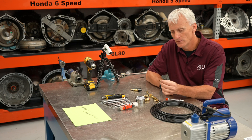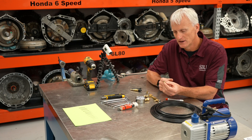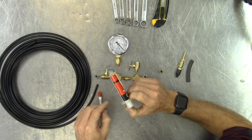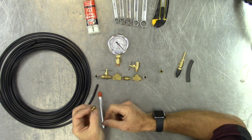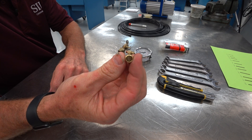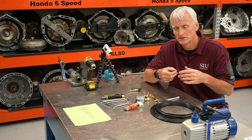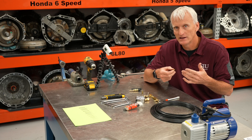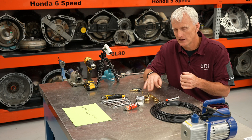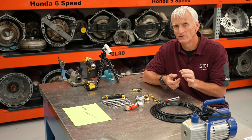I've filled part of this little nipple with two-part epoxy — you mix it up and put it on the inside of the nipple. You only want to fill it about an eighth of an inch with epoxy. I made a couple of them just in case. After that hardens up, we drill through it to create a test orifice. And if you ever watch my videos, you'll notice that we always calibrate the gauge — so when it's plugged off, it's got 25 inches of vacuum, and when it's flowing through an orifice, it's going to pull 5 inches of vacuum.